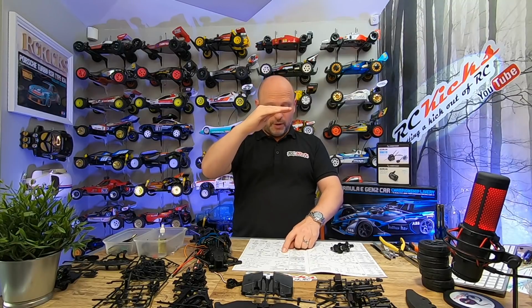So you've got two choices. One, you have to measure them, or two, which is the way I did it, is if you flex them a little bit, the 0.1s are softer because they're thinner, and the 0.3s are harder. So I would recommend you sort them out first, because when you put in the diff, you put a 0.3 and a 0.1 at the top and the bottom.